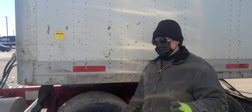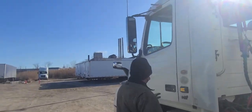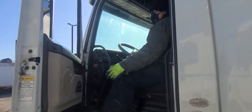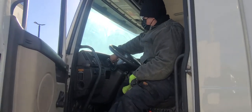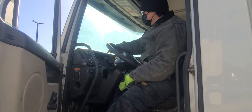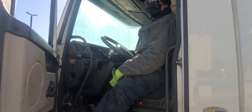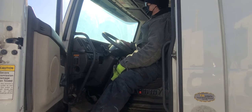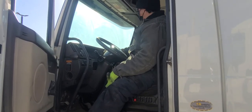So now the last step, first thing you have to make sure is that the pressure is above 90 PSI. So you can come up. So my pressure PSI is over 90. Volvos, you have to bring the key back on. You're gonna hear that, that's your ABS system. So my pressure is over 90 PSI or a normal operating range.